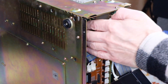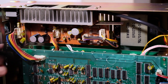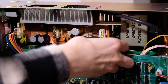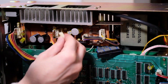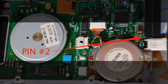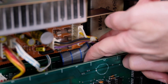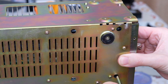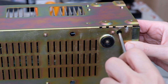Feed the power and data cables back into the sampler through the drive bay opening, and maneuver those connectors between the power board and the PC board. It will take some finagling since the cables have less slack because the emulator body is shallower than the original drive, but it can be done while the emulator waits on the edge of the drive bay opening. Reconnect drive power in the one direction possible, paying close attention that the blue stripe aligns with pin 2 on the PC board. Even pressure on both sides of the data cable connector will pop it into place. Finally, hold the plastic emulator body firmly against the bracket while tightening the screws to lock the GoTek in place.